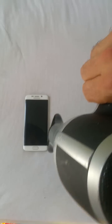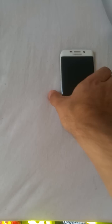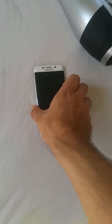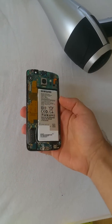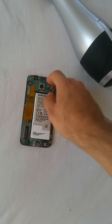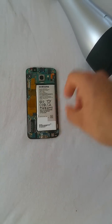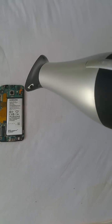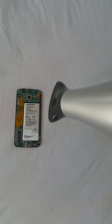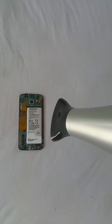Keep the hairdryer a little bit far away from the touchscreen. If that didn't get a result for you, you can do what I did — disassemble the phone, remove the mainboard and any other cables and ribbon cables, in order not to damage them from the high heat.